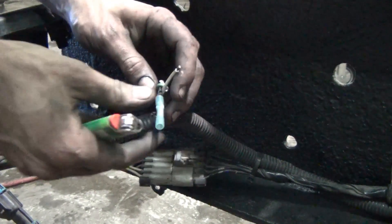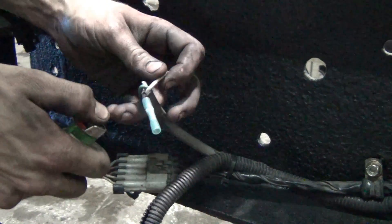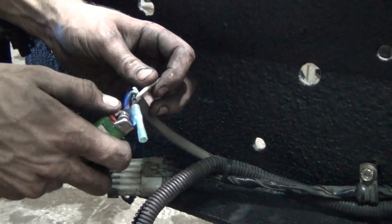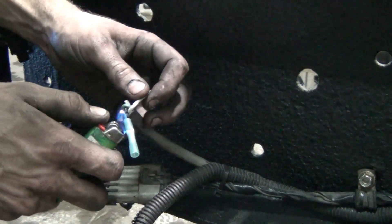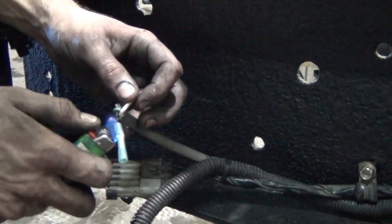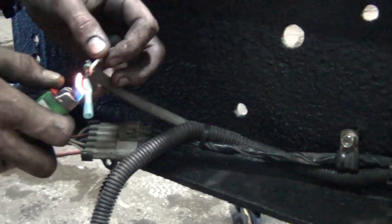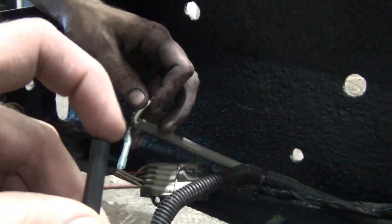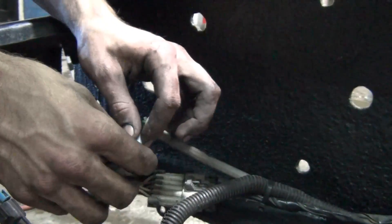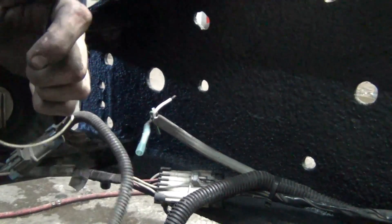We're doing the last few wiring touch-ups, and I want to show you what I consider — and Kevin agrees — is a really good best practice. Never do any wire connections without heat shrink, and we're doing it twice. These crimp connectors have heat shrink of their own, but we're also going to be using another set of heat shrink with some nice adhesive on the inside right over top of that, to make sure that it's sealed well and never gets any moisture or corrosion in there.